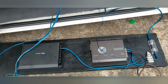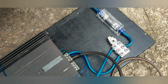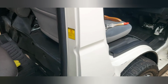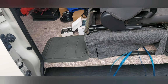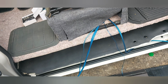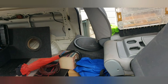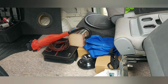Amps rack. I'm going to wire up the amps rack. You get some battery terminals, but I use them like a distribution block. Put one fuse there, so I can wire everything outside and just push it in. I ran the wires through the loom already, so I wired up the amps and they're powered up already. I put in another speaker, bored holes, and ran the speaker wire through. So most of the job is covered already.